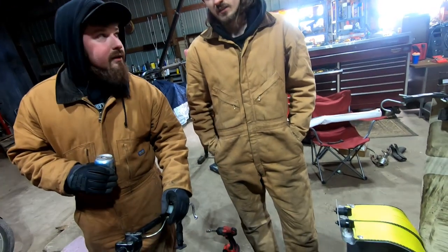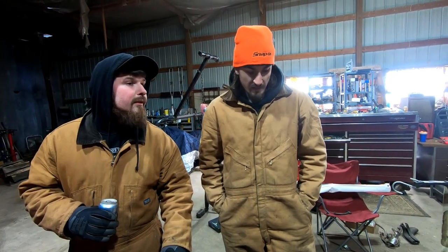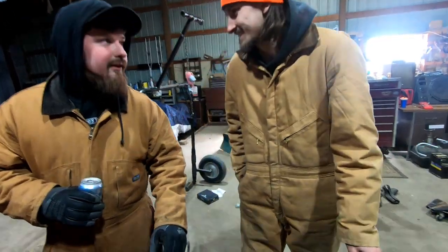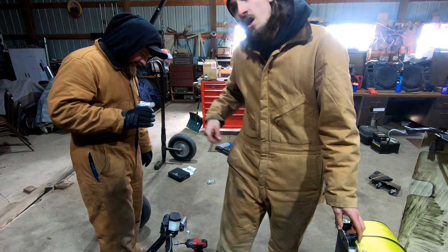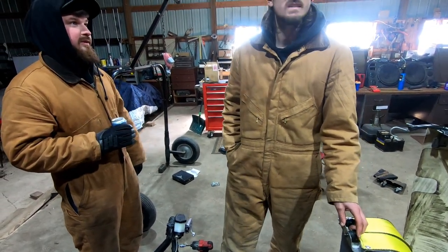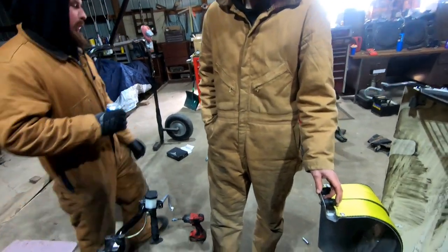So we actually didn't make it the full season without catastrophic failure. Technically, we did because we were pretty much done. We didn't have a catastrophic failure at a race. Right. I mean, if we went to Benny Mulder, we would have found this out before that. We have a new piston we could have thrown in it and just ball honed it and sent it. Sandpaper, just in one spot. And then it's all uneven, so it's getting blow by.